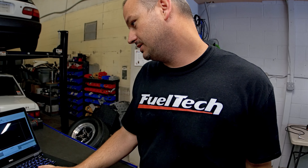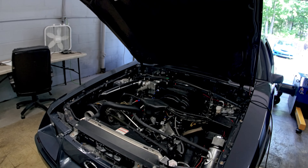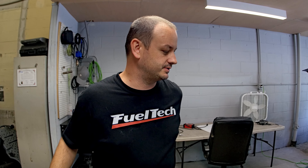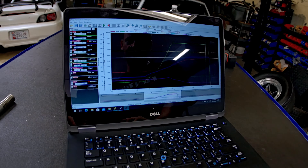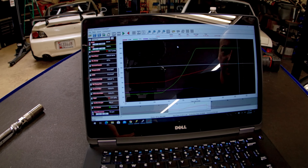This one's unfortunate because at only 10 pounds of boost — his goal was to make 500 — and it was only at about 5,500 RPM. Another thousand RPM and it'd probably make 500, no problem. So 500 is about the limit on these stock blocks. It's got a little bit of aftermarket parts in it, but at this point the block itself is the weak link. I don't remember what size turbo was on it — probably a 76 or somewhere around there. I pulled an insane amount of timing out of this thing just to make sure it wouldn't explode. Start really conservative because you don't know if you're going to lose 40 pounds of fuel pressure. Have it real aggressive from the get-go and the next thing you know, it goes through the wall.